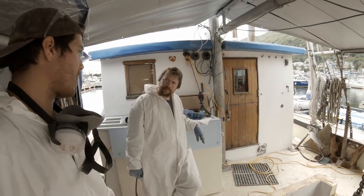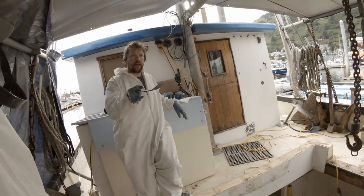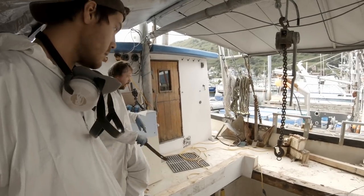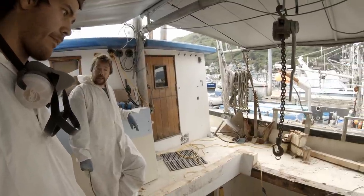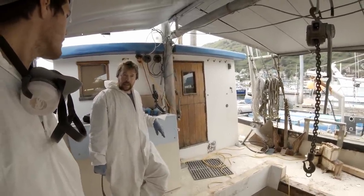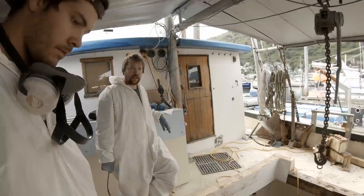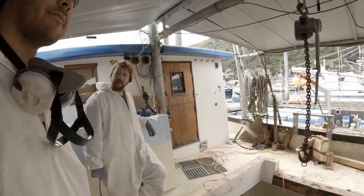Started the day with a full coaming, and now we're almost down to deck. Well, I'm glad that we took the time on those not to destroy them. In retrospect, I really thought that we would be reclaiming these lower ones, but it looks like it's quite the opposite. It won't take very much to clean those up and get them in shape, get the gel coat knocked off, and we'll go ahead and put down a thick layer of laminate on what's there. It looks like it's bonded well. Yeah, I'm happy. It's all good.